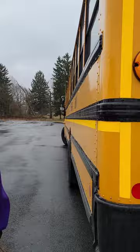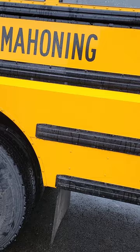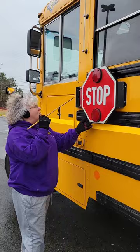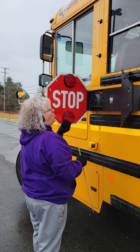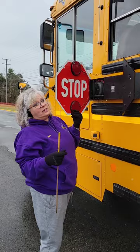I like to stand by the tire because it lets me see everything I've got to mention. I would check my lights, tires, wheels, brakes, suspension, and underneath — the same on this side as I did the other. I come up to my stop sign. My stop sign is secure to the bracket, bracket is secure to the bus. The four red lenses — two on the out, two on the in — are secure to the sign, not broken or missing. The wire is not broken, frayed, or bare. The airbag is not cut. Retraction cable is not broken. The airbag won't be leaking at this point because there's no air in it — so stick with it's not cut.